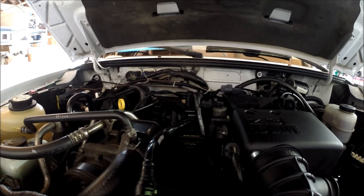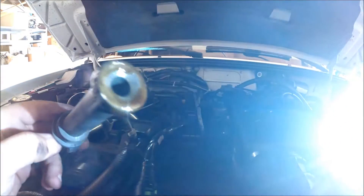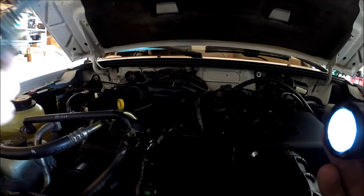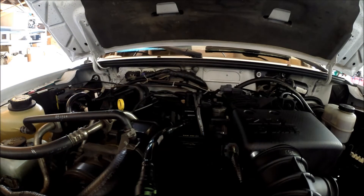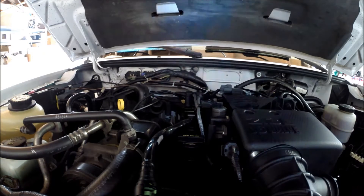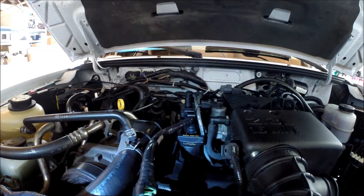That's not good. As you can see, I have oil in here, which means most likely it's a valve cover gasket problem. So I may be looking at doing that in the future, which is fun and exciting — because that's exactly what I wanted to do before my drive to Idaho. There's no way I can physically do this before I leave for Idaho soon.